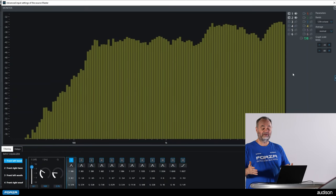We are ready to move forward tuning the front stage. Checking the rear speakers: there is the left rear, there is the right rear, and together both rears go off the chart. After adjusting the level, we can see that front and rear are in phase and aligned in time. There may be a little delay on the rear speakers compared to the front, but it doesn't look serious. Since we won't run the rear speakers very loudly anyway, it won't be a big problem in the tune. Let's bring back the main software window and get ready to tune.